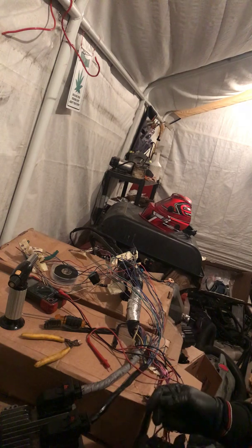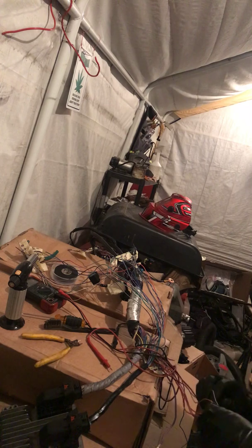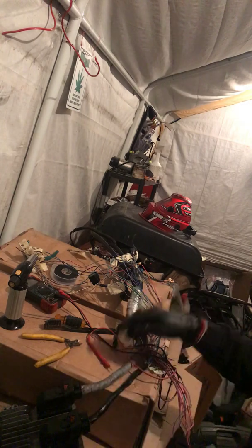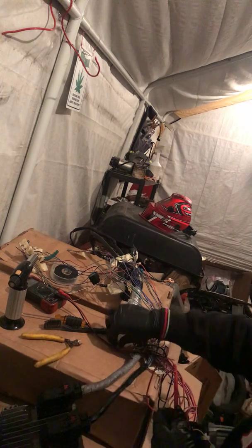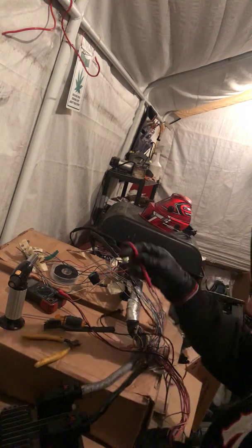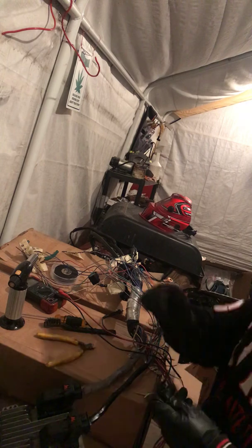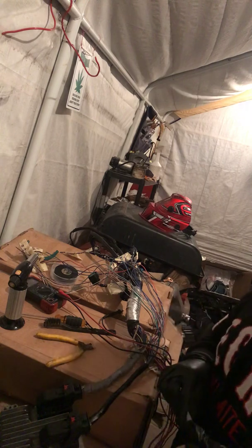Next up are some grounds — just one ground here. Let's go through your starter control. I like to double-check that it is indeed a ground. This ground used to go to your starter control solenoid, but we're going to be using it for the OBD2 port.